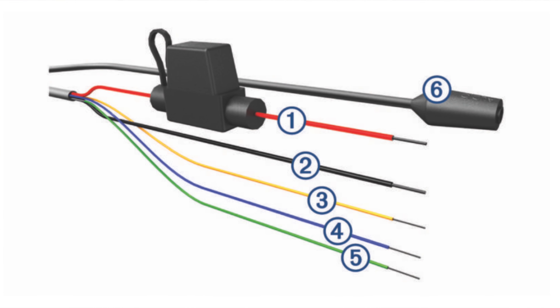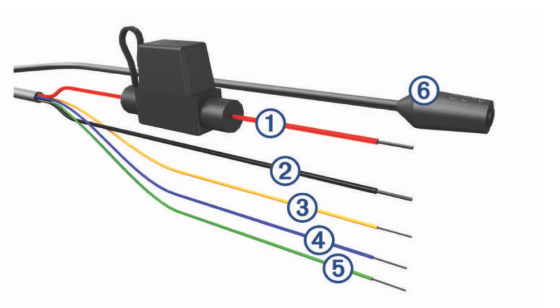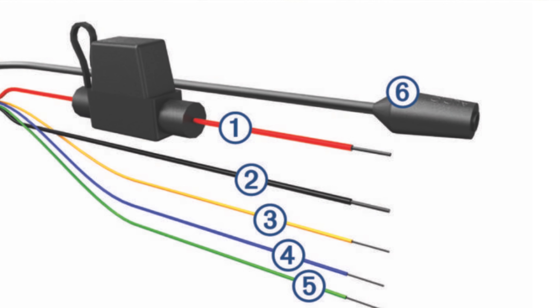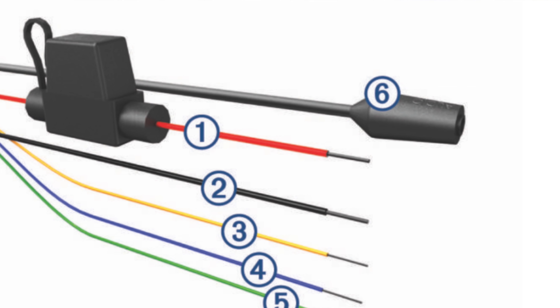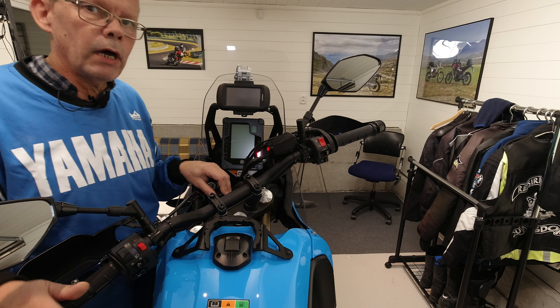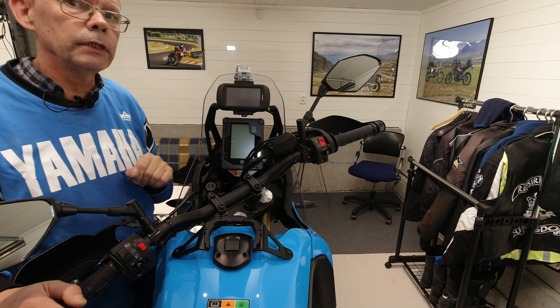The red and black ones. The cable also contains an audio output because some Garmin GPS units don't have Bluetooth audio communication, so you have the option to take audio from the 3.5mm audio jack integrated in the cable. I don't need that audio, so I just cut it off. I also cut the cable to a length that was suitable for my mount.